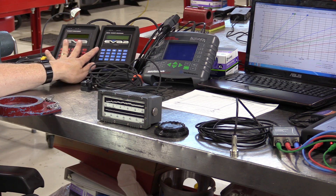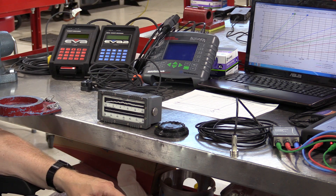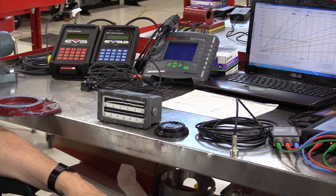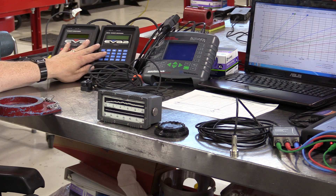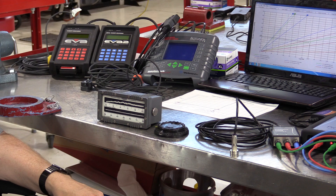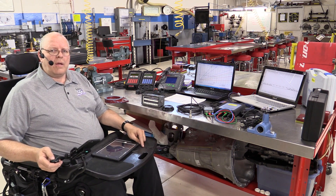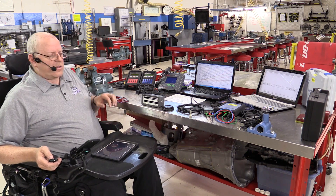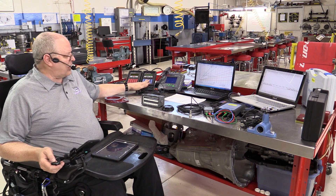The second video was on the Electronic Vibration Analyzer. There's an early version that came out in 1991 with the red keypad, and a blue version that came out in 1998 with the blue keypad — it's the later version called the EVA 2. Both of these I purchased off eBay; they cost me around $400 each, and both are in almost perfect shape because they had not been used by dealership technicians. These typically would sit in the back of a room and nobody would ever use them because they were too difficult to use — too difficult to understand what the EVA was displaying. All it was displaying was vibration frequencies and vibration amplitude levels, but it did not help you determine what part on the vehicle was responsible for the vibration. The second EVA, with the blue keypad, attempted to do so but it only had software written up through 1998, and it only worked on GM vehicles.